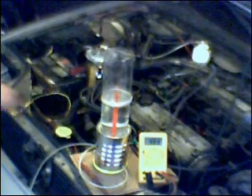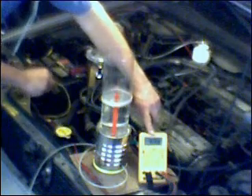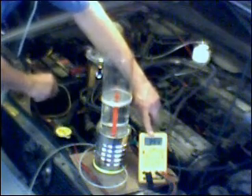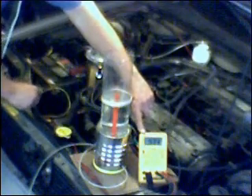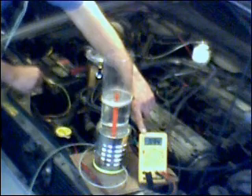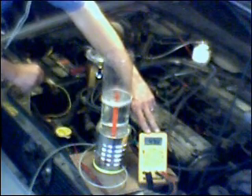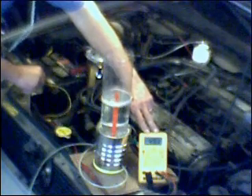So when I turn on the electrolyzer cell, what's going to happen is, as I'm monitoring the voltage on the oxygen sensor with this meter right here, the voltage should fluctuate as the HHO gas begins to flow. The difference in the fluctuation, or the difference in the average value that I record here, is going to be the baseline number that I start with for the injection voltage of the electronic fuel injection enhancer.